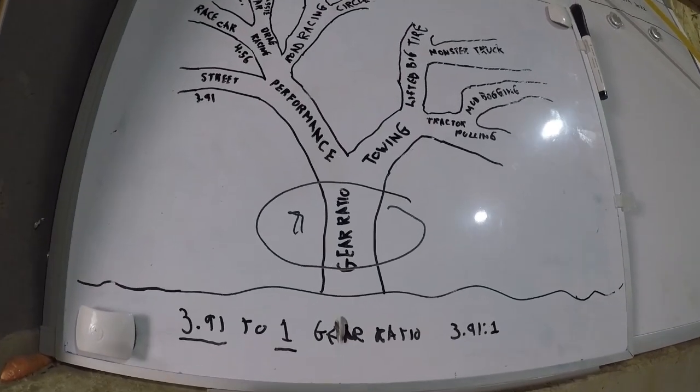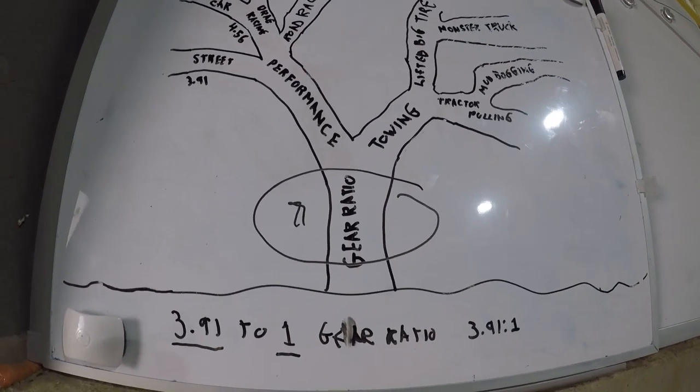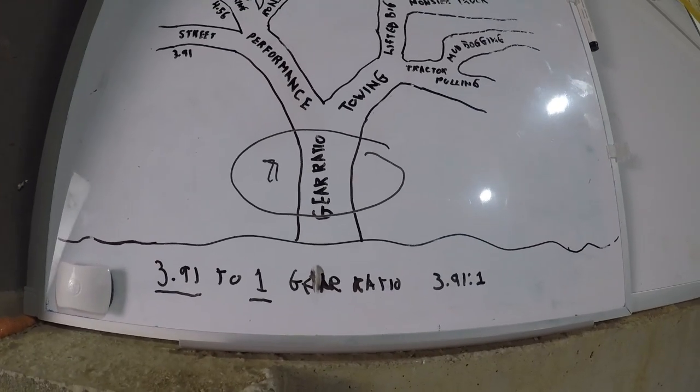I will show you the two other ways of finding your gear ratio a little bit later on. But first, let's talk about the pros and cons of different gear ratios and what's going to work best for you. Let's say you have some really tall gears and it cruises down the highway really well, has plenty of accelerating power, can pass anybody, works pretty good — but you get into the city and from one traffic light to the next, it's just a dog. So you want to put some lower gears in it. Let's say you had 2.76 gears and you decide you want to put 4.56s in it. That's roughly double the gear ratio, which means you're going to double your torque — not really the horsepower, but for simple terms let's say it works that way because it's more the torque you're going to double.